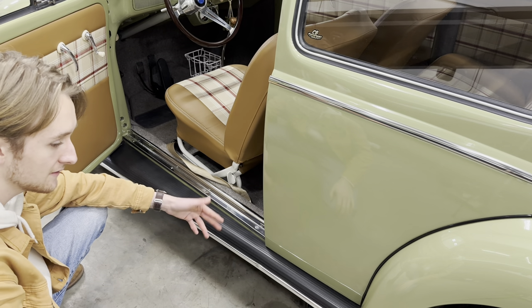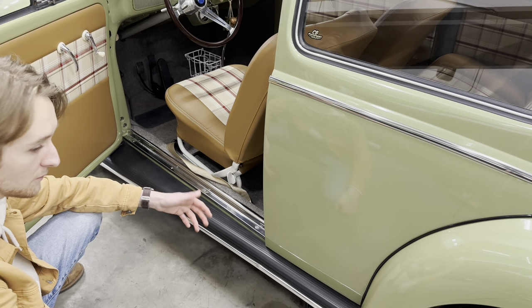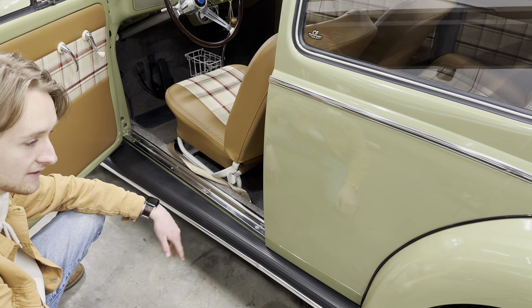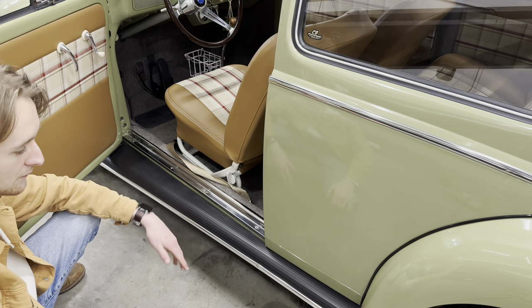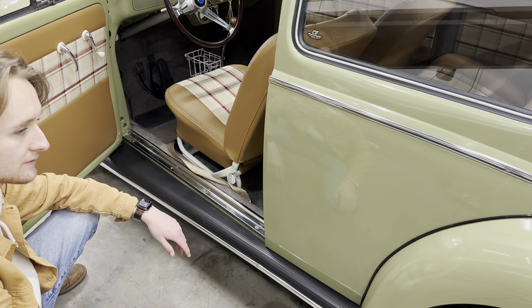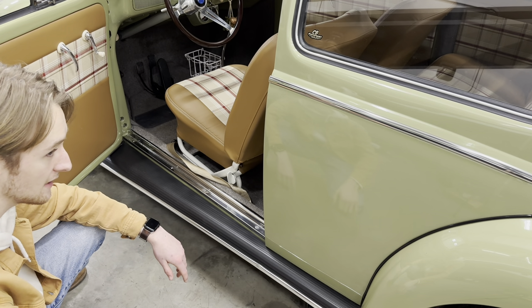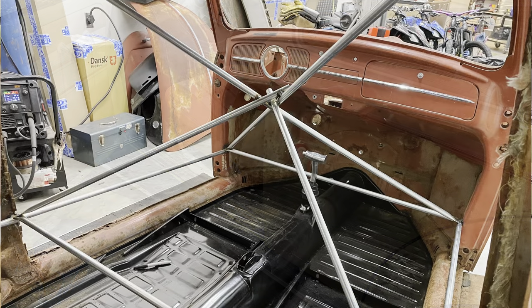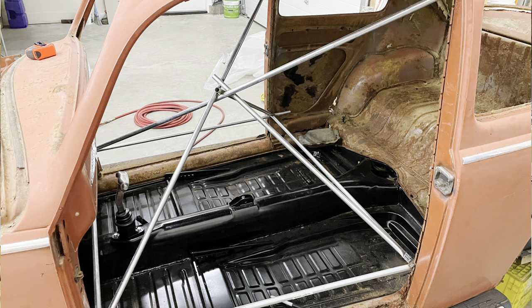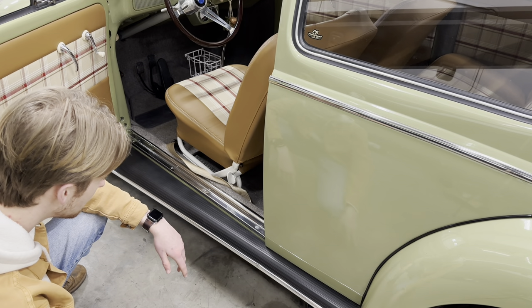My heater channels were very rusty; I had to replace them. The big trick I almost didn't do — I was procrastinating on cutting mine out because I had the replacement ones but I was not looking forward to doing it. So I started to grab the grinder and was about to just straight up cut them out. My dad, thank God, said I should build a temporary cage inside of the car so that when you cut out the structure, it doesn't twist weird and make it so nothing lines up properly ever again. Thank God he said that because I would have really screwed myself over.